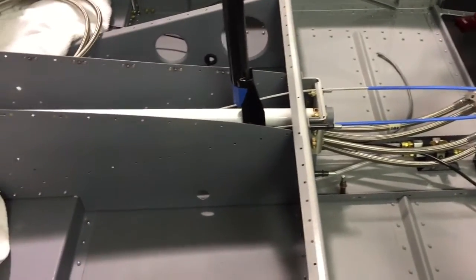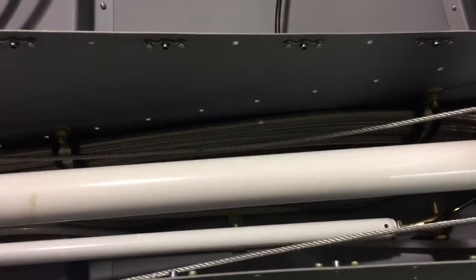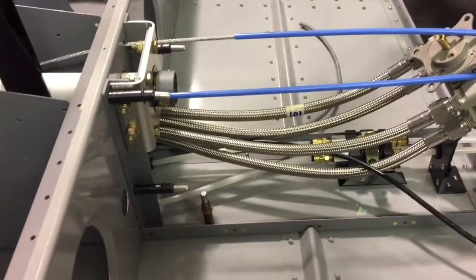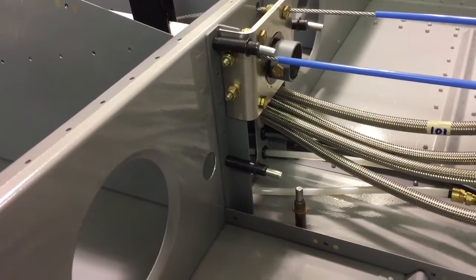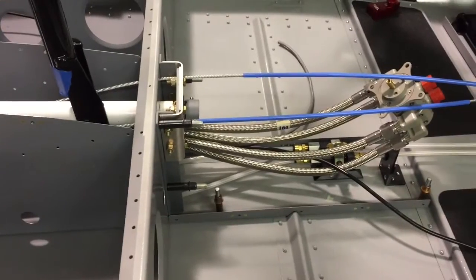Final clip on this video — I couldn't leave well enough alone. I did route that fourth line in here. So now I have all four lines coming from the fuel selector, going down the pilot side of the center, and off to the back where two of them split one way and two split the other way. It's a nice routing — I won't have to cut a slot in this side piece. Unfortunately, I already drilled a hole here so I'll have to find a creative way to cover that up — maybe some sort of data plate I can rivet over it. But I do like that all four lines are running down the center now. It's a real nice, neat installation.